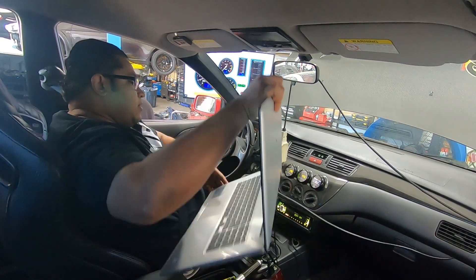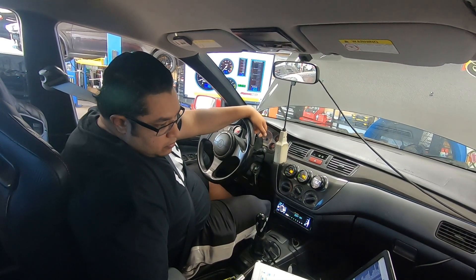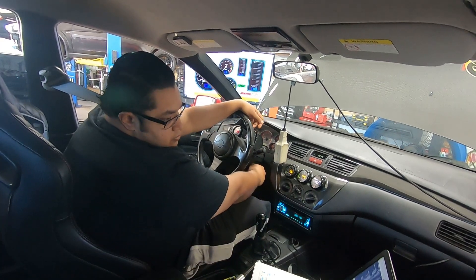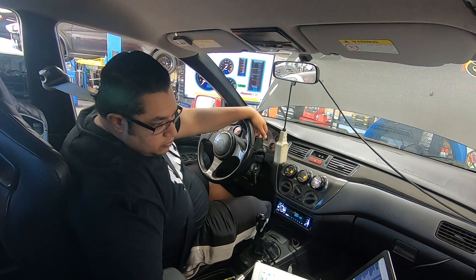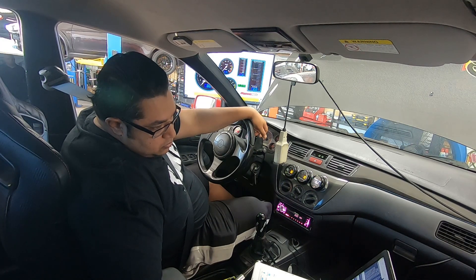As I'm doing more of these videos, the inner relationship between me and Moe - we are like brothers - is coming out. I literally treat him like my brother and sometimes like my sister. He's a good dude. Sometimes I concentrate so much that I don't want people talking to me - this is one of those times. I'm adjusting the VE right now slightly to make sure part throttle is perfect. These built motors are more sensitive to per-percentage fuel AFR changes than a normal car. I've seen where I had to put some of them at part throttle at 13, 12.5 in order for it to run correctly - this is the reason why part throttle and pre-boost is so important.